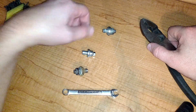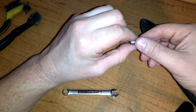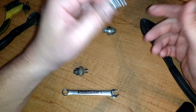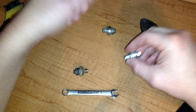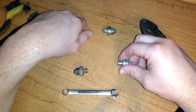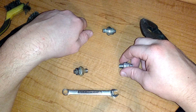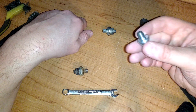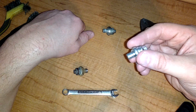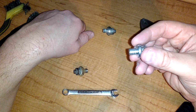After putting in these brand new ones, I noticed that the engine turned over faster — it definitely sounded like it had a new battery versus an old, worn-out battery. I turned on the AC full blast and noticed the voltage was higher, so probably the alternator was not able to fully put power to the battery because of the bad connection. Now when I tighten them down, they're gripping and pushing those cables up against that battery post. Definitely a good investment.